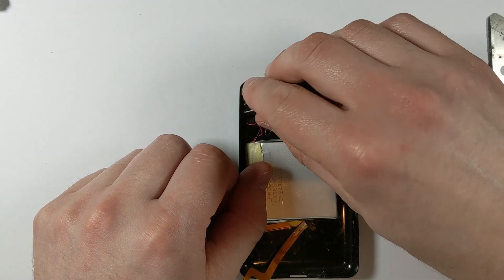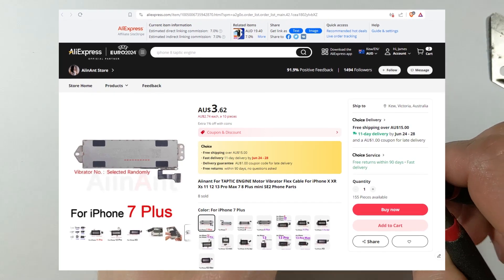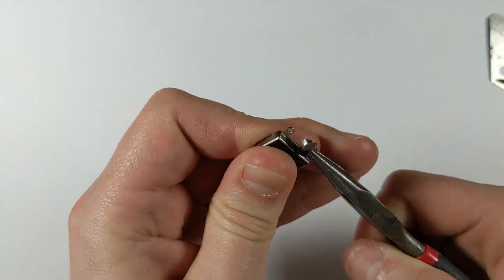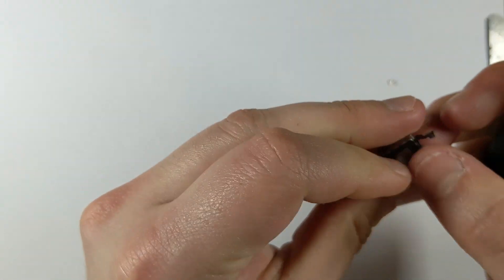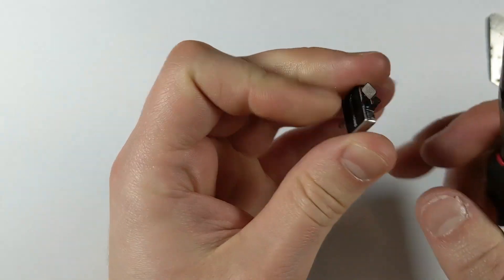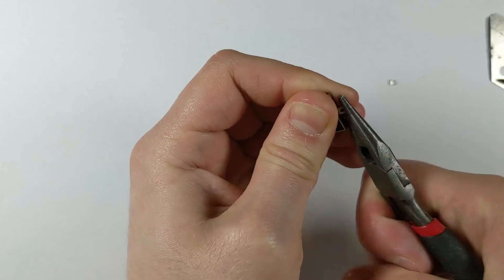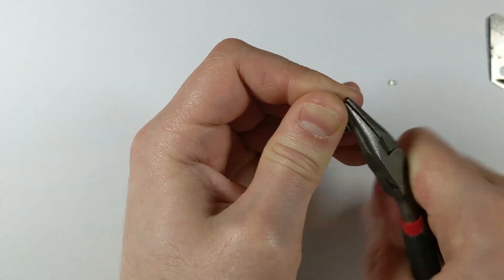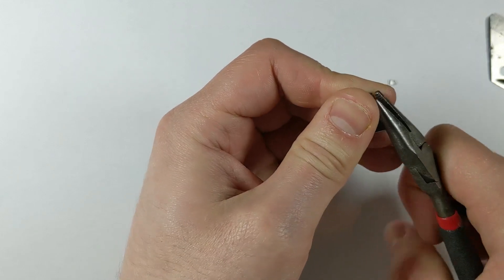From what I've read online, it looks as if the larger Taptic Engines — for instance the ones in the iPhone 7 and 8 Plus — will give a stronger vibration than the smaller ones, although I've not personally tested it. But that is something to keep in mind if you're interested in doing this mod. The only downside being it might limit what other mods you could also fit in here. So if you're going for the max vibration, maybe consider an iPhone 7 Plus Taptic Engine. But if you want to do it as I've done here and also fit it alongside the Bluetooth mod, the iPhone Mini one is probably the best choice.